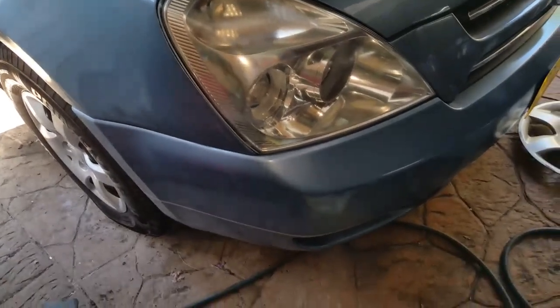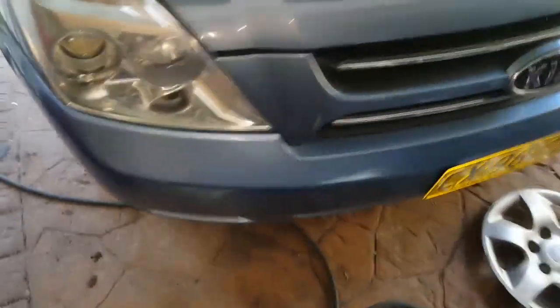Well, that's all back together now. Just wanted to show you, it didn't turn out too bad, but I want to share a bit of what I found with fiberglassing on the outside. You see these little craters that have come about? That's the fiberglass breathing. When I was spraying, I put so many coats of spray putty over that, sanded it, sprayed it, sanded it, sprayed it. When I started running out of spray putty, that's when these little holes started filling up, and the fiberglass stopped pushing all that paint back out and leaving all these little holes.